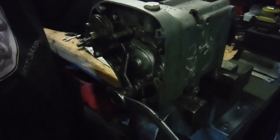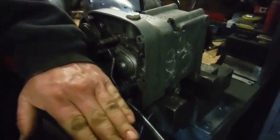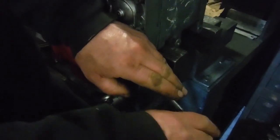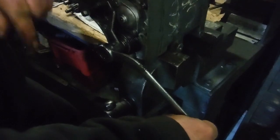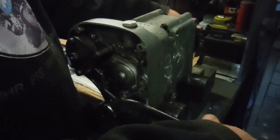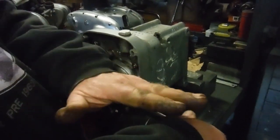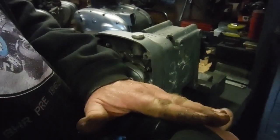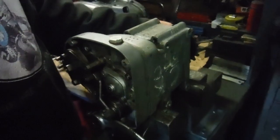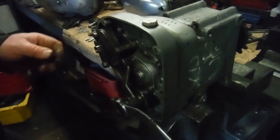But you can feel where it goes into gear, and any excess movement. It's gone click and I'm holding the gear lever there. If I could move that down a little bit further and then let go and it springs back, then I know that it's going too far in the upward change direction. Likewise, changing down, if it goes beyond where the mechanism clicks into gear, there's a little bit of springiness afterwards, then you're going too far on the downward side and you're probably not going to go far enough to get good clean upward gear changes. And I think that's probably about all I need to say about this.